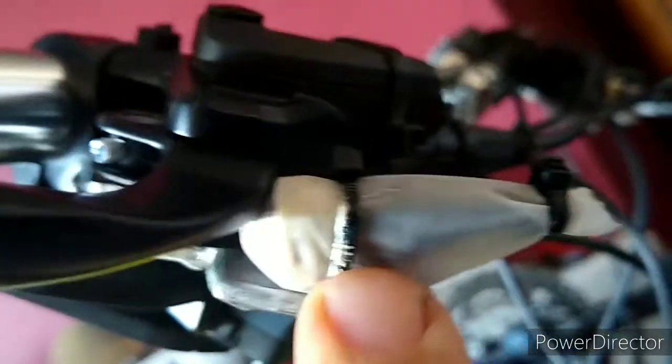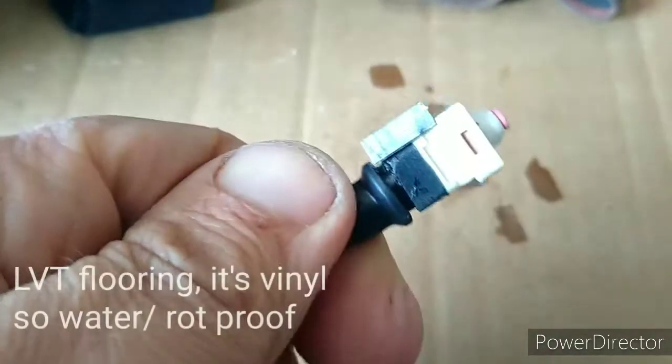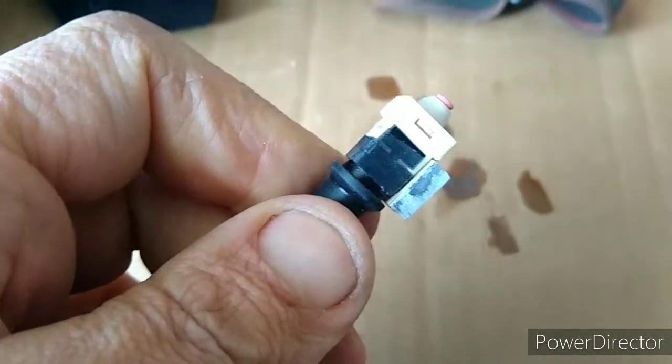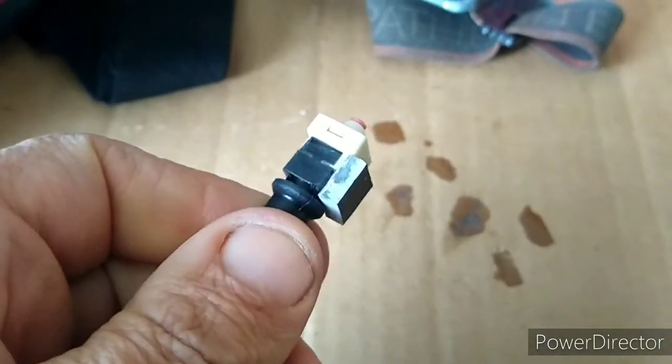Just a brief addition to say — overnight, on day two, the little foam blocks under here have crushed, so I need to replace those. I found a couple of tiny offcuts from a piece of laminate flooring. This is a much harder plastic material than the foam I used — it was closed cell foam, but unfortunately over time it crushed and changed the clearance to the lever and stopped working.